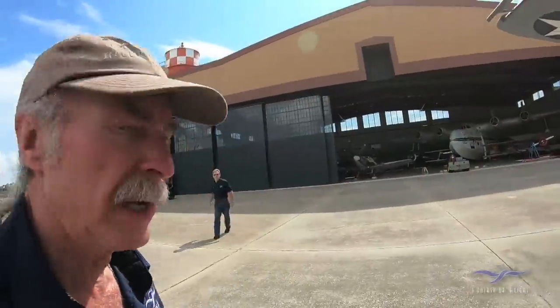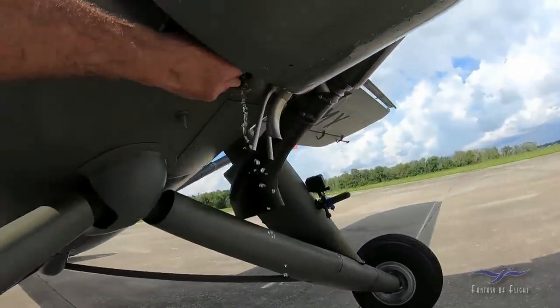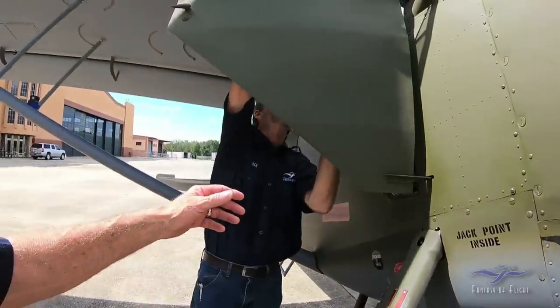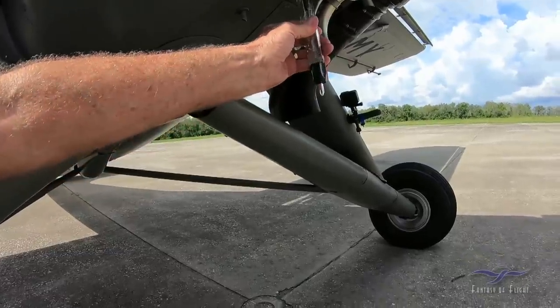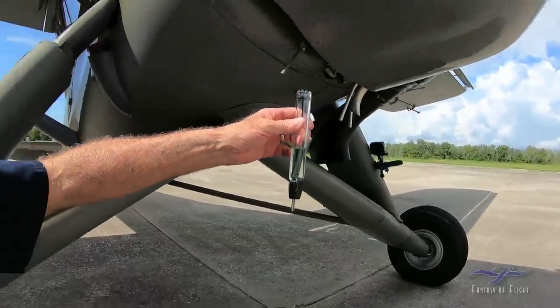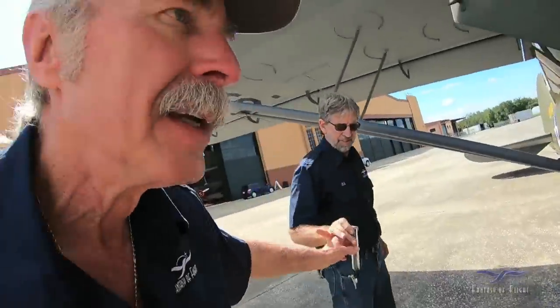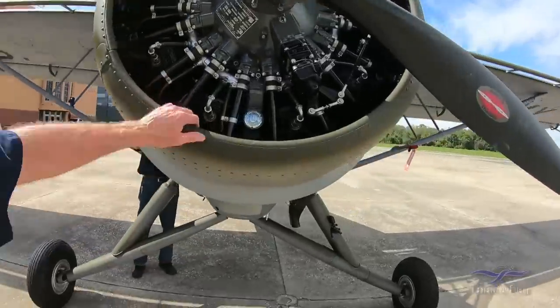When we put the airplane back in next time, I know exactly where the wheels have to go from the chalk marks and tail wheel mark. Let me do a bit of a walk around. Jack, at least drain the sump again. The sump is right here — I can smell it, it's not water, it's fuel. What happens is water weighs more than fuel, so if there had been any water in there it would show up in the bottom of the tank, and that's where you pick it up to where it goes to the engine.